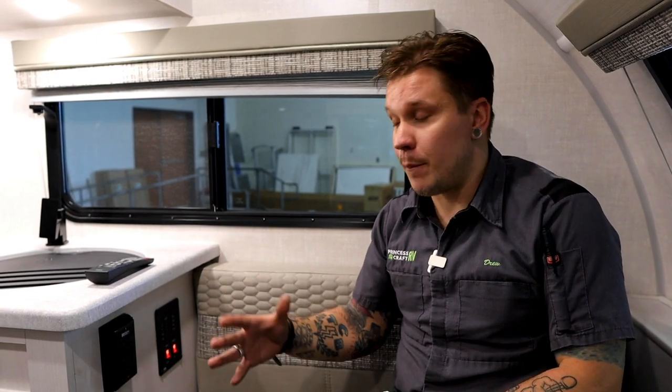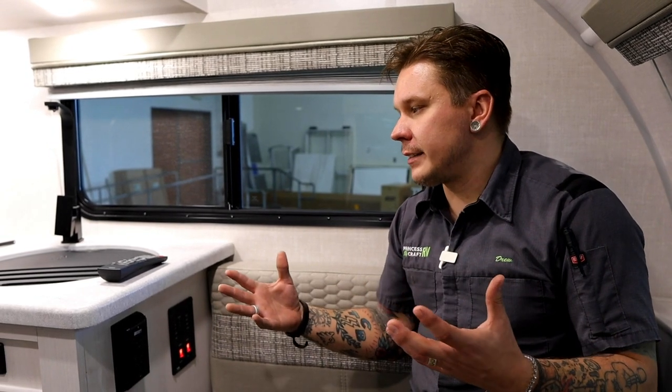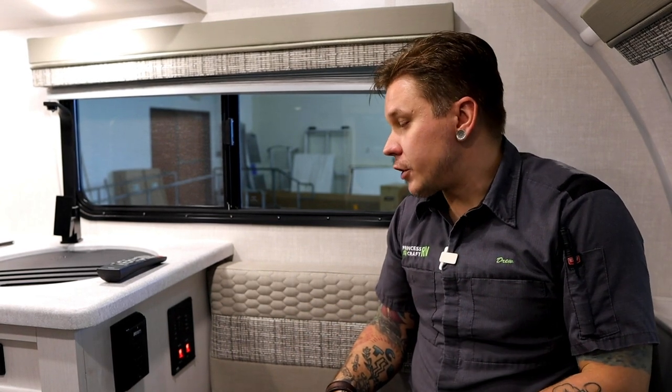What that means is maybe you're out of propane gas up front. Maybe your bottle is not turned on, but either way, ultimately it means that that water heater has not lit on propane. In the event that that happens, again, if the lines are empty, it's not going to light the first time every time. So in the event that it happens, of course, make sure your bottle's on. If it's on, that's excellent. Make sure you have propane in the tank.